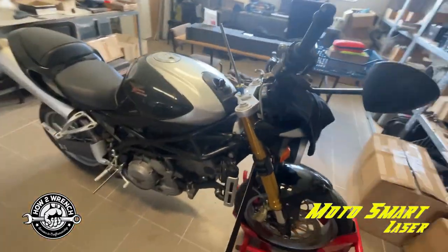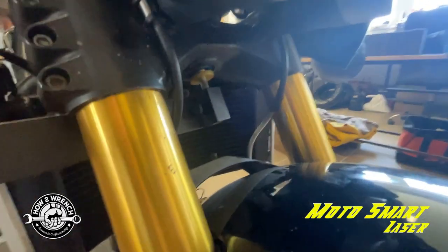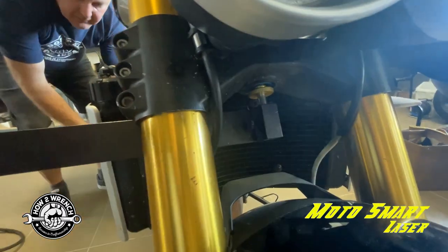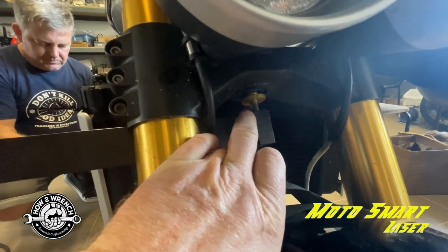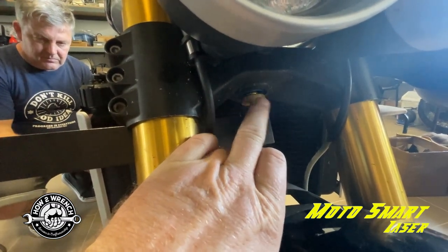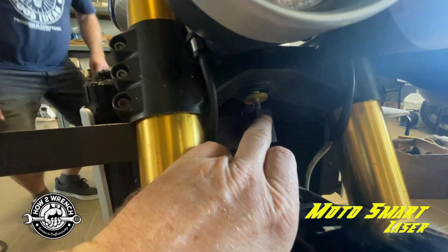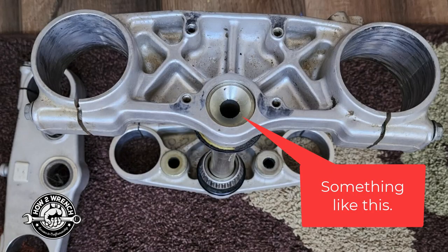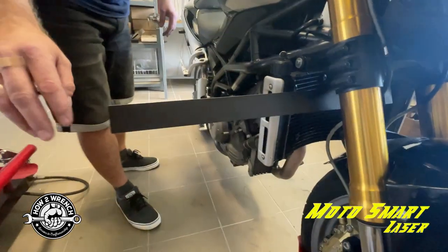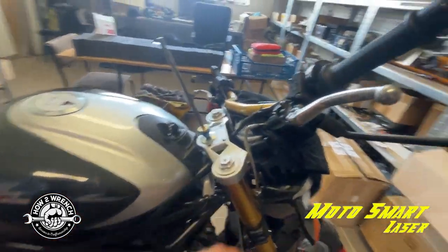Let's look at the front setup we already have here. We have the shaft through the triple tree, and the scale is sideways. One point he made is don't just try to throw these in — you want to get under there and make sure there's not a weld across that would prevent you from centering it up. This is not going to work on every model, but in this case it was machined through on both sides, so we had two good surfaces to get cones on, and then we have our scale.